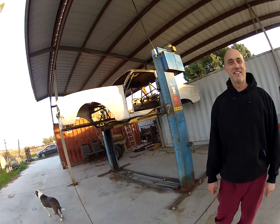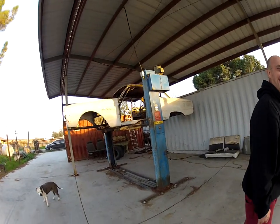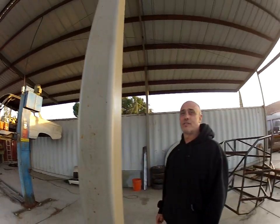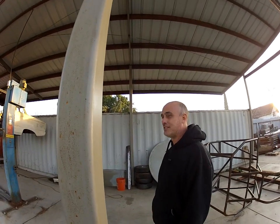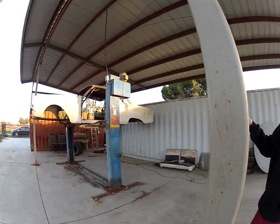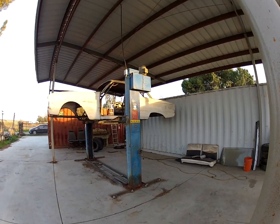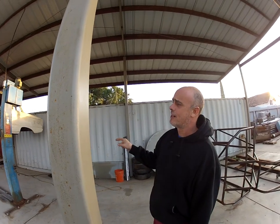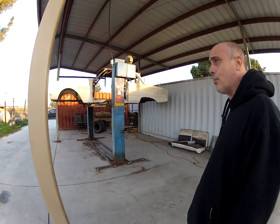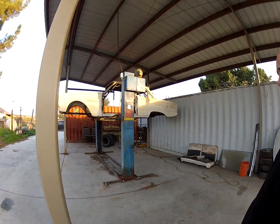Wow. 2,200 pounds. Now you're going to have all the tire tucked underneath the back, yeah? 18 inches by 33 inch tall. Dang. Yeah, it's the steamrollers. But I'm actually going to hang the four-link suspension on it to where I can put a 10.5-inch wide, 29-inch tall tire on there so I can run small tire. Okay. Street. It's the no-prep street crap. I want to be able to do small tire and big tire.